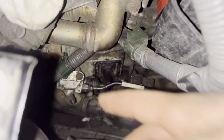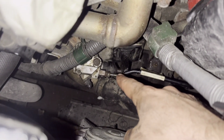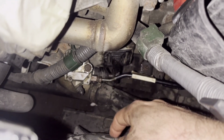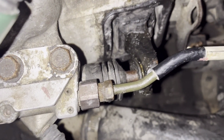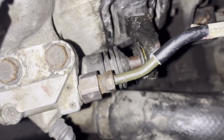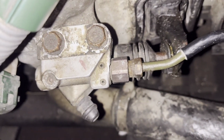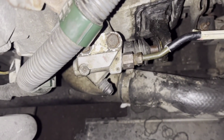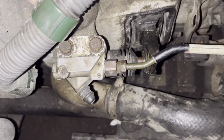So yeah, it's not that complicated. The pin of the piston of the cylinder here is flexible, so it may go right and left a bit, especially if you remove that small holder there, it will be easier to fit it back. You fit back first the cylinder and then that one. While you are fitting this, you can fit that one at the same time. So you put back the bolts almost as tight as they were.